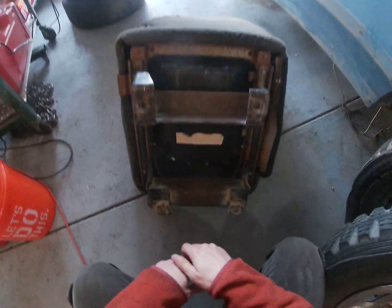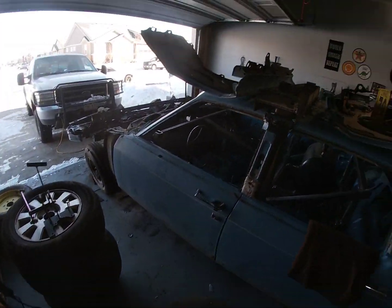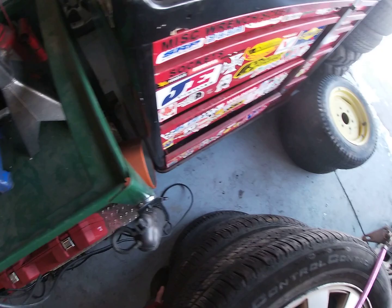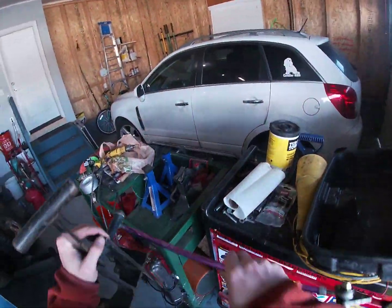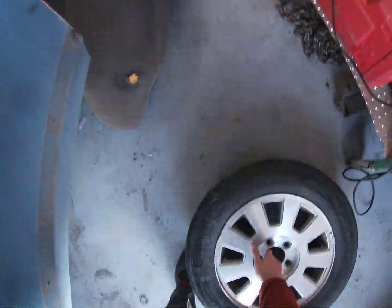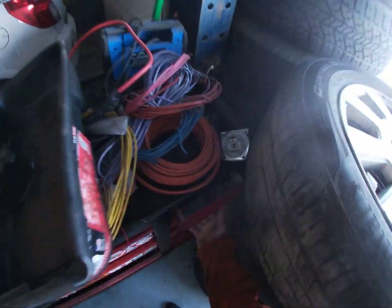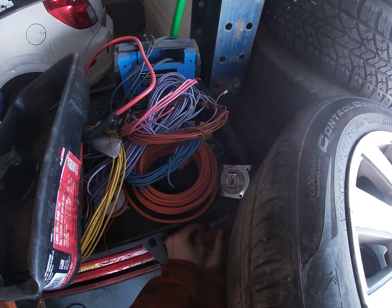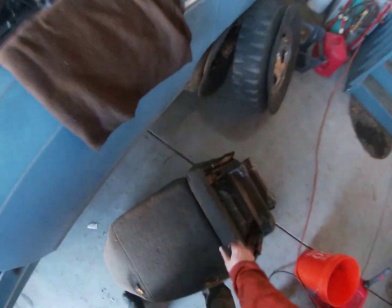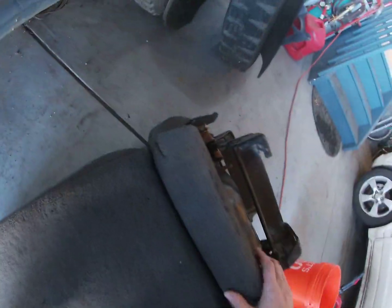We don't have a lot of options as far as where it's going to go because we already have welded in our back bar. And these Crown Vic tires are going to be a problem, so let me move these real quick. We're probably just going to cram it as far back as we can go, with the restriction of the back bar that we'll be facing. Once we get it in position, I'm going to crawl underneath there and mark through the holes with this Sharpie, and then I'll drill down through from the top. So first thing, let's get this bad boy in here.